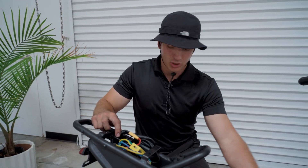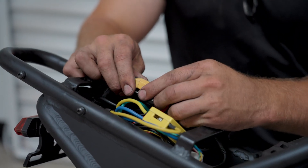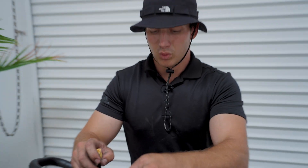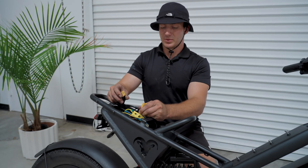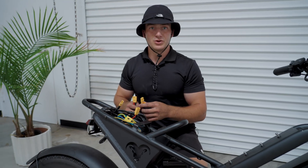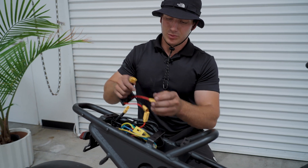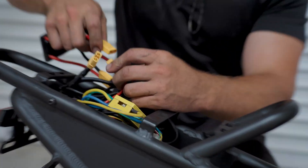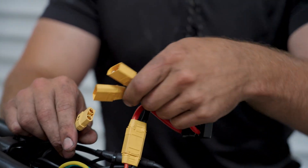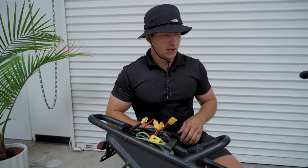Now that we have the seat uninstalled, you can see the original OEM battery that is installed on the bike is already plugged into the controller — that's perfectly fine. All we're going to do is unplug it. One end comes out of the controller, the other end is coming from the battery. We're going to take our battery balancer — and don't worry, there's only one plug that you can plug into this section, so you can't really get it wrong — and plug the battery balancer into the controller section. Then we'll plug one battery into this plug and the second one will go into the other one.